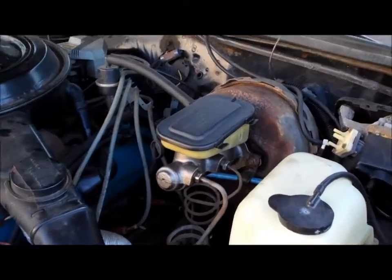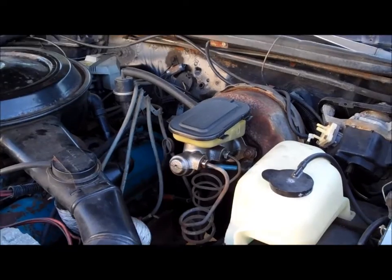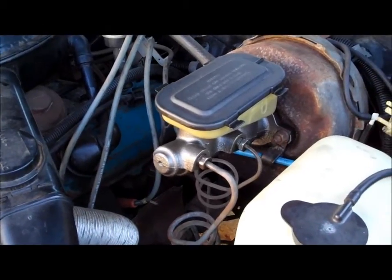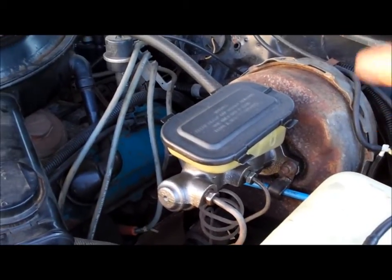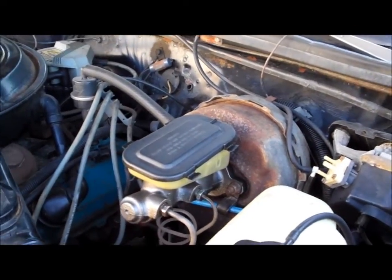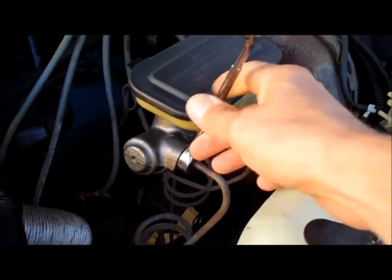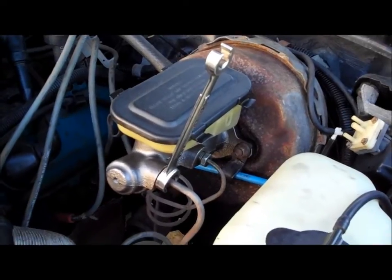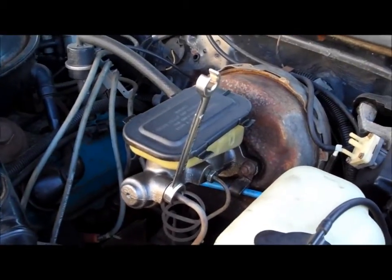The master cylinder is on and the brake system is ready to be bled. A couple of tips: you might ask how does the fluid not dump out when you remove the bleeder lines — basically you put the cap back on before you remove them, and it creates a suction so it won't drip out, or drips out slowly enough to get the cylinder mounted. Also, this right here is a line wrench — always use a line wrench when loosening brake lines or fuel lines. Don't use a standard box wrench or you'll round off the fittings and have to replace the line.